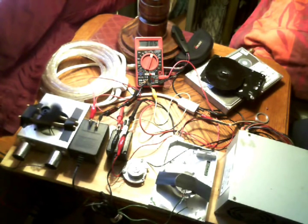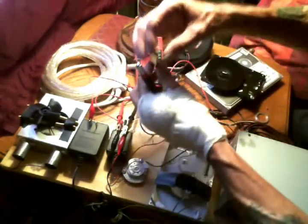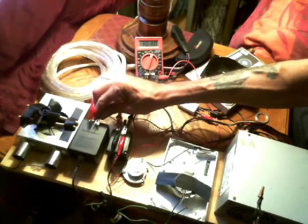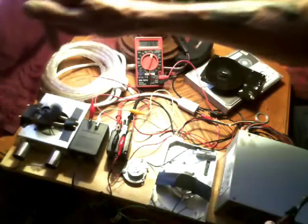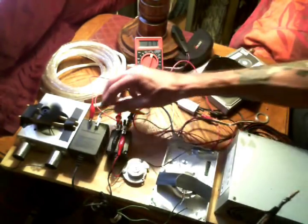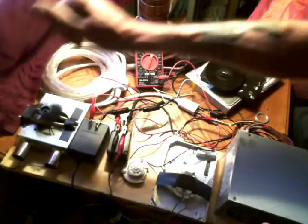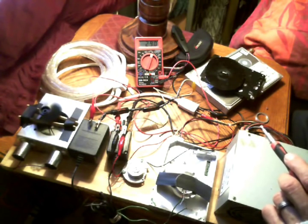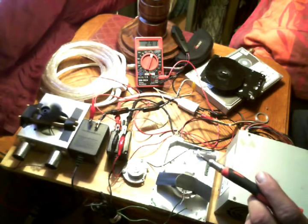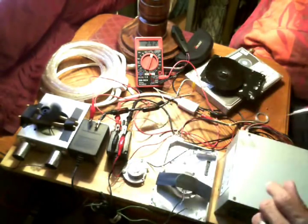It is running a little fan. I'm sure with a little tinkering with some capacitors I could get that fan to self-start. Let me show you something — when that's running it's 17.7 volts without the capacitor. If I connect the capacitor, you notice it jumps up to about 29.0 volts. So I think with a couple of strategically placed capacitors, and I'm going to try out a whole bunch of these different little transformers to see what the best results are.